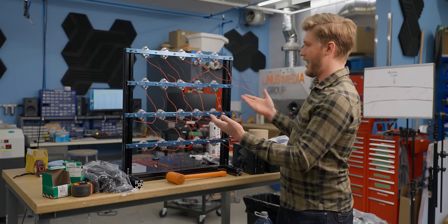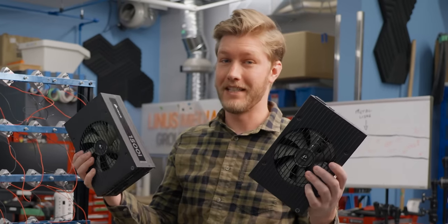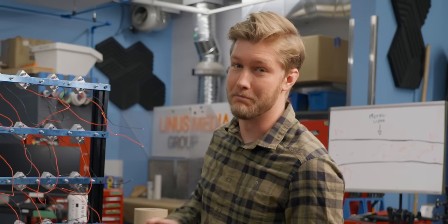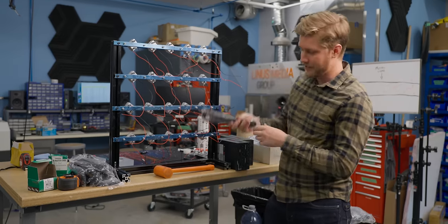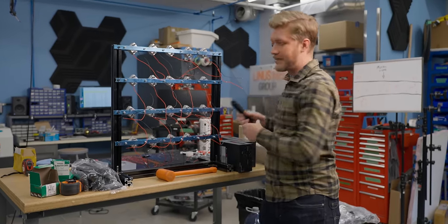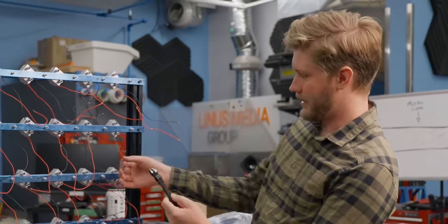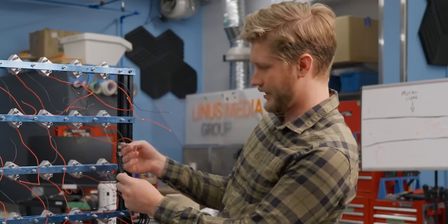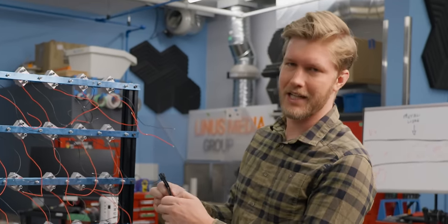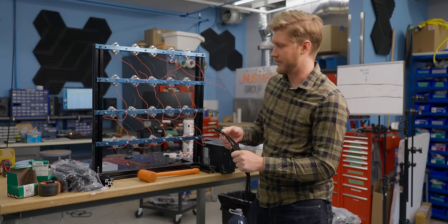How are we going to power this thing? Two Corsair 1500i power supplies. We're going to have to use two circuits or we'll blow one of them. To connect it, we have these CableMod cables — we're just going to be chopping off the leads and soldering them to the TECs. We'll probably do two TECs per EPS cable so the wires don't catch on fire — we'll verify that with the FLIR later.